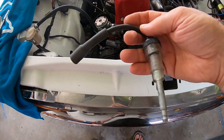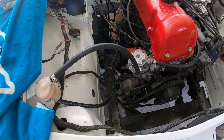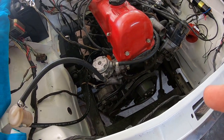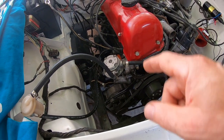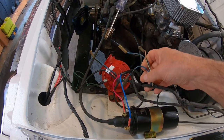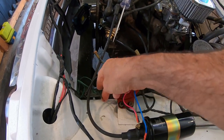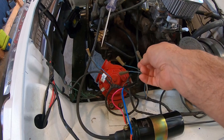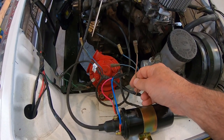Now that I got the engine running, I'm going to take out this little coil tester since I know I've got spark. I put the fuel line back to the tank — got two gallons in there — so I'm going to try to run and pull gas from the old tank. There's also a no-idle issue; I need to get the timing correct, and I probably need somebody to help or use a hot wire. I'm not happy with all these extra wires at the distributor. I need power for the carburetor choke, and this blue-with-white wire is everywhere — goes down to the fuse box and I'm not even sure what it's for, though I think it could be reused for the gas pedal.